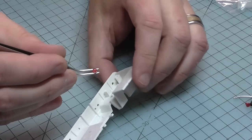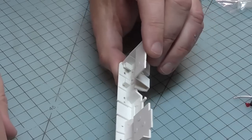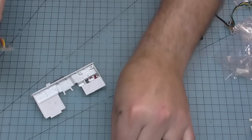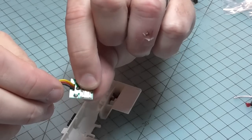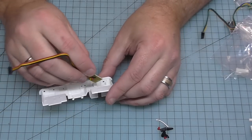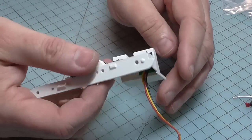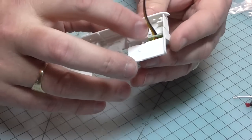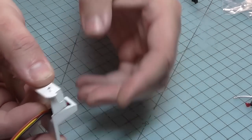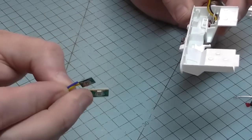When they're in they look just like that. We've got to put the PCB board with the switches behind it - as you can hear they click. This one is going to slot into the channel just behind those switches we just installed. We want it quite deep in there so it holds its own weight. More importantly, if I hold it can I push these buttons? Yes and yes. Now we've got another PCB board - there are actually two attached to this cable. The other one is going to operate the horn.